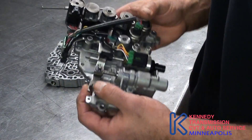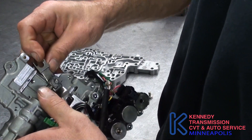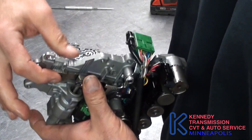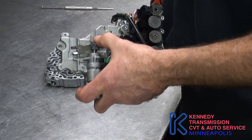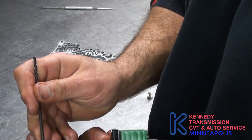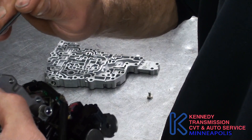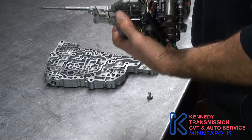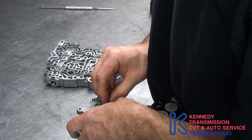When you do get this back together, this has to line up when you're putting the valve body — it has to line up on a piece that's connected down to the sheaving. They give you a little pinhole here that you can use to hold this back when you're putting it on. I put a little bolt in there just to hold it for assembly purposes.